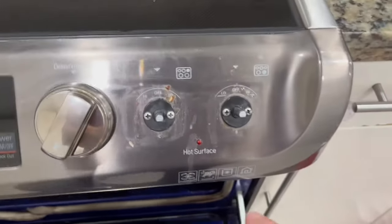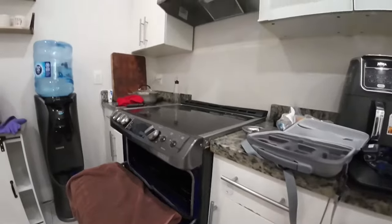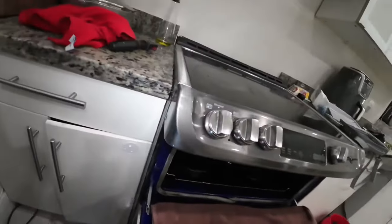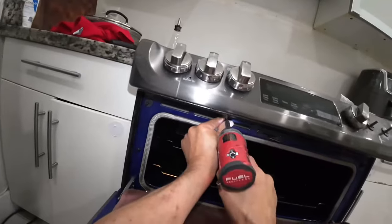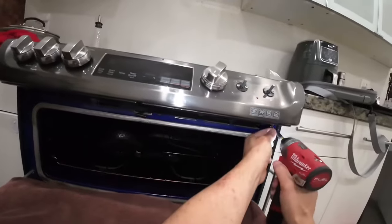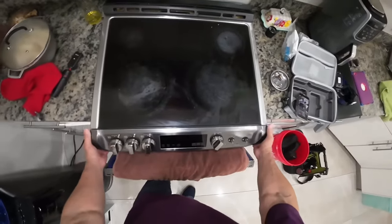We're going to have to remove these two screws and these little black washers that go over the stem. I'll be removing my six screws from the control panel quickly, then pick off my four screws on the bottom. Make sure you disconnect your power before lifting up the control panel — now you lift up this control panel and turn the bottom forward and up.